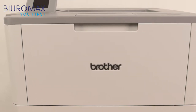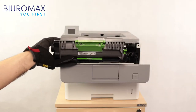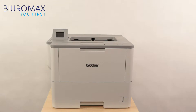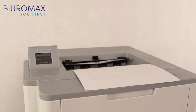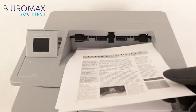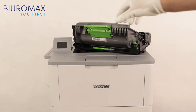The toner test for remanufacturing toner Brother HLL 6400 cartridges was carried out from April 6 to April 12, 2023. The purpose of the test is to check the quality and yield of the toner in a test run of 3000 pages. Test sheets with 5% toner coverage were used. In the test room, temperature ranges from 22 to 23 degrees Celsius and humidity is between 31 to 35 percent. The original toner is removed from the printer and replaced with a cartridge regenerated with a test powder.